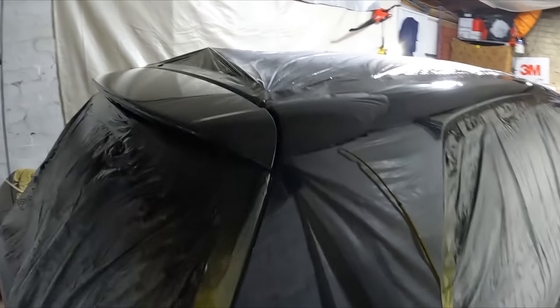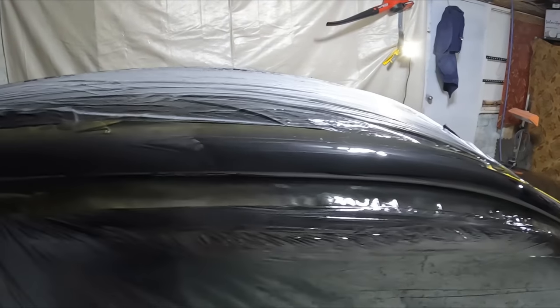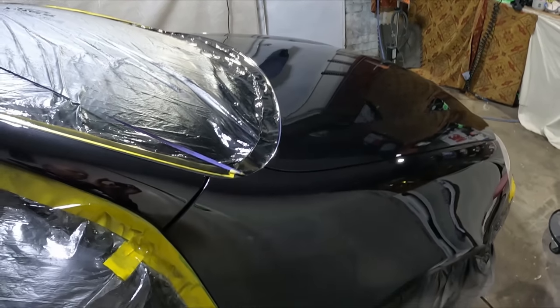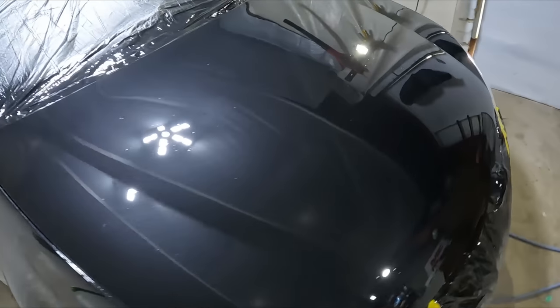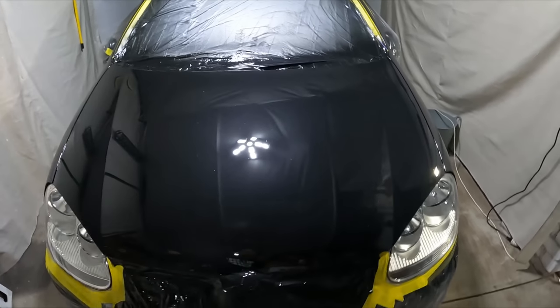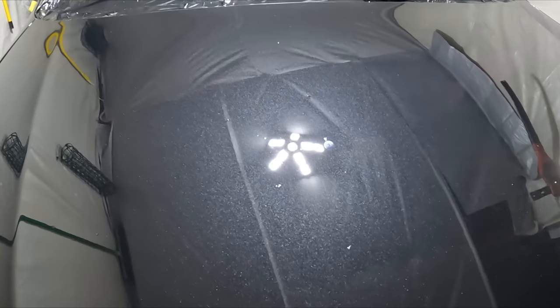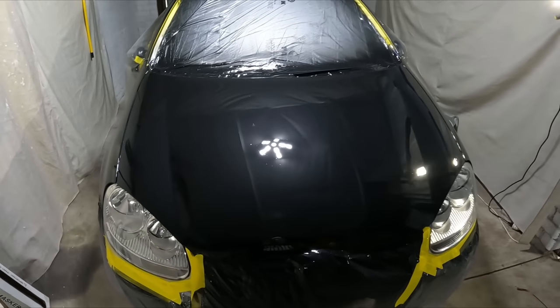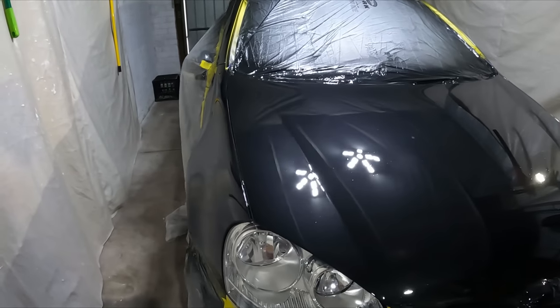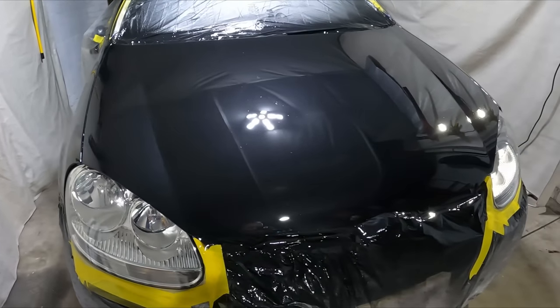That looks pretty damn good. There were a couple of spots on the roof where the masking tape actually peeled off the paint when I unmasked it, so I'll need to do a little touch-up — if it's that bad we could paint the roof since we've got color left over. All the bits of dust in it are just raised sections that will sand back flat with 1500, 2000, 3000, and 5000 grit — it's just going to take a little bit of time and you'll be left with a dead flat finish. As long as I'm not getting silicon spots through the job, that's a positive. That compressor ran at two bar for five-plus minutes and did not dip at all — really happy with it.